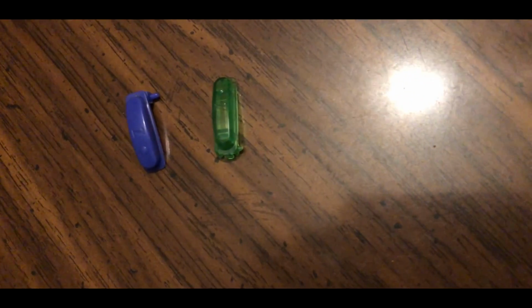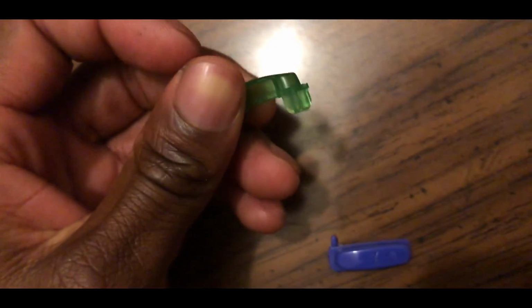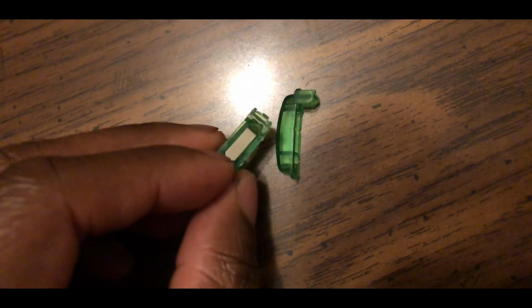The Z button requires so much effort to fit it into the controller, it's almost not worth it if I'm being completely honest with all of you. If your adjustments to the Z button are not well done, you can have an incredibly stiff button or even one that gets stuck. There are a couple videos explaining how to adjust the Z button to fit, so I won't get into it too much. The trick is to cut the back peg of the third-party Z button entirely off, then sand the side of it down so it fits in. After doing this to two different buttons, it definitely doesn't feel like the stock Z button. However, I did a pretty good job adjusting it, and I personally think it's close enough for my tastes.